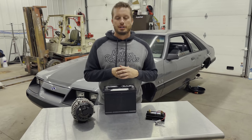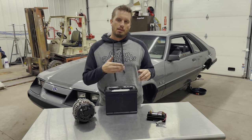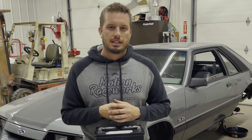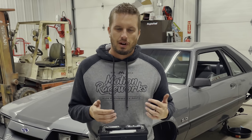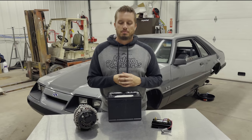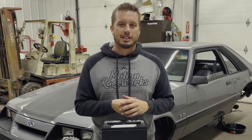Just remember: don't loop your alternator back in with everything else that powers your car — it'll keep running, it's improper, and you'll never get your kill switch to work properly. There are some kill switches on the market that have a breakout for an alternator, but most don't, so this is how it needs to be done. If you have ideas for the next Tech Tip Tuesday, please drop them in the comments below — that's where this idea came from, an overwhelming request on how to properly wire an alternator with a kill switch. We'll see you next time, and hope you have a great 2022!